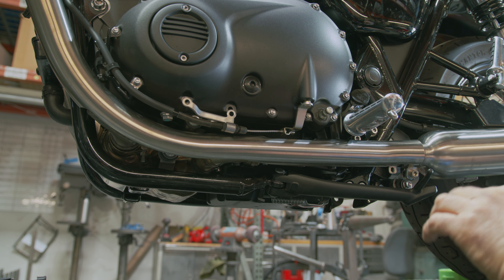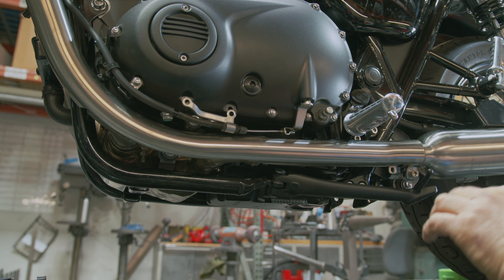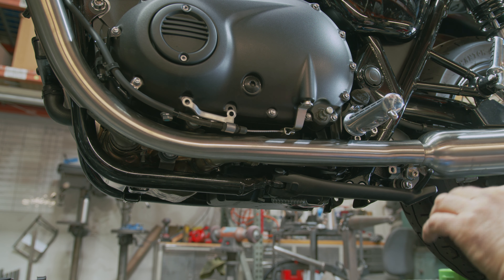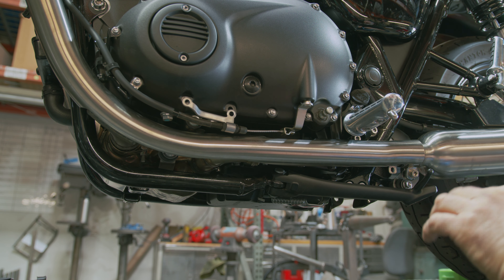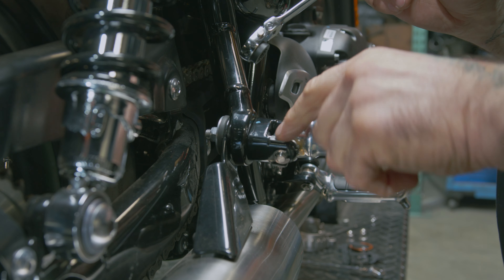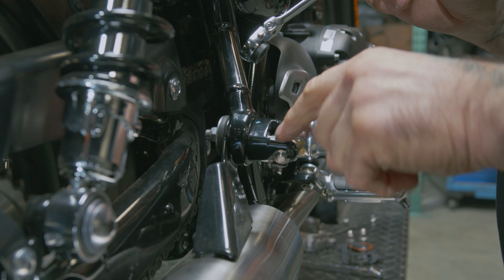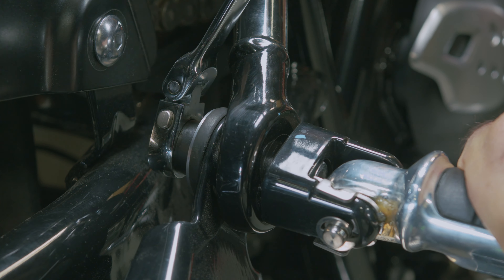With our 6mm Allen and 12mm wrench, take that off. Gently bring it in this way so you don't hit your swing arm, and pull back. Now we want to loosen this clamp with 6mm Allen. Here I'm going to show you a little shortcut so that you don't have to pull the pin. Put your 12mm wrench on the backside, and if you apply pressure down here as you're doing it, it should keep that bolt from spinning so you can get the nut off. If you're not applying enough pressure, that bolt will start spinning — just keep pressure down on it.